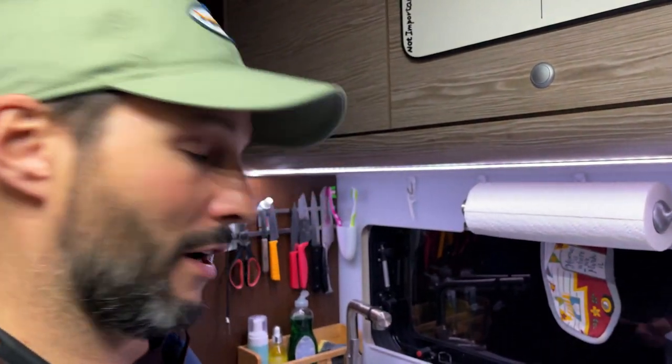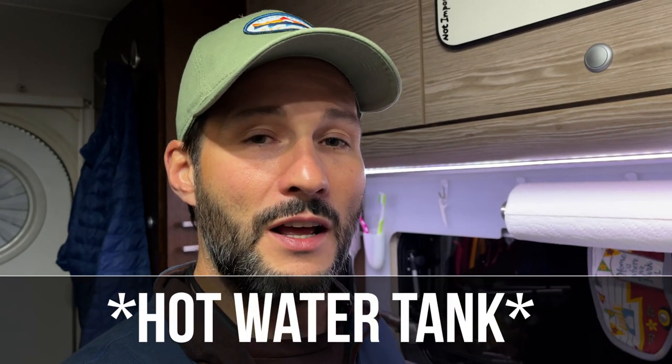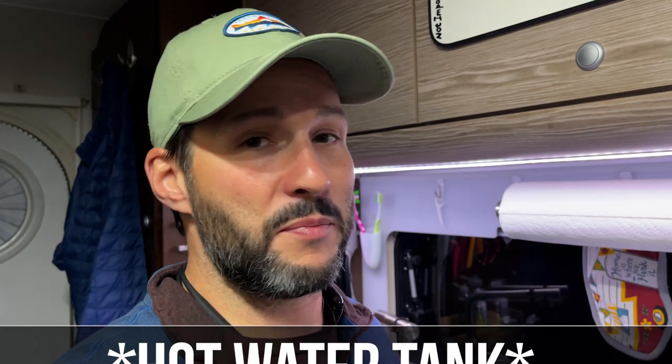That's what I do every six months or so, sometimes every three months, and we've been on the road two years. We drink out of our faucet and tank pretty much exclusively and we've never had a problem. We do run it through our Brita filter and we're looking at maybe getting a Zero filter or a Berkey in the future. Now for the disclaimer: I'm not a professional — I've Googled how to do this and learned through my own experience, so your system may vary. I try to be really thorough so everything gets touched with chlorine. I know most water tanks can be sensitive to chlorine, especially when hot, so make sure your tank is bypassed and the water stays cold. Apparently chlorine and stainless steel — especially when the water's hot — is very, very corrosive, and I don't want that to happen to my tank.